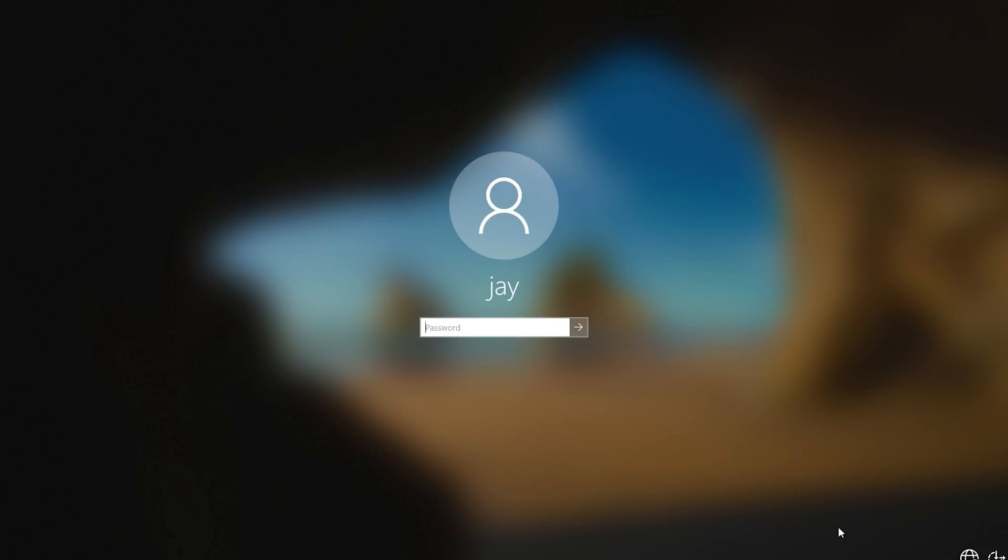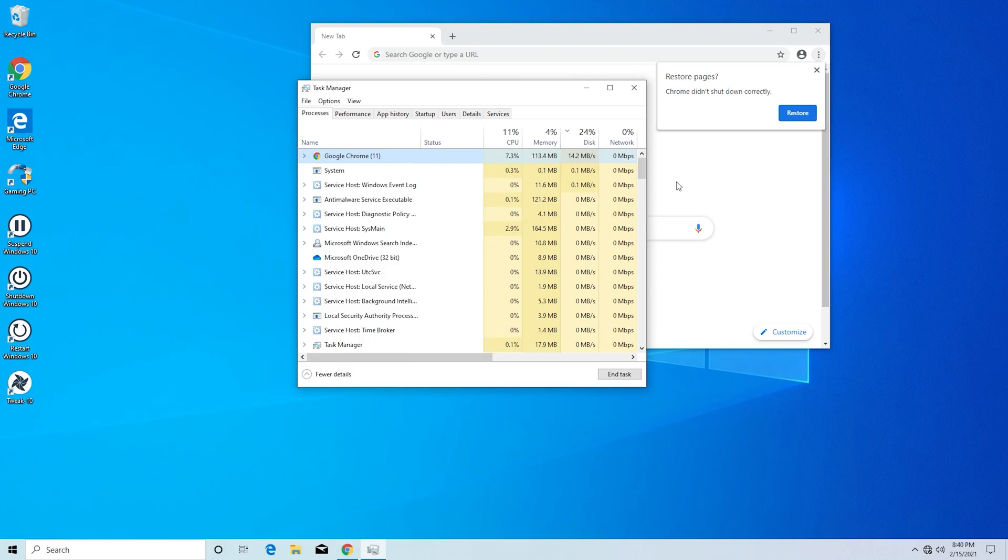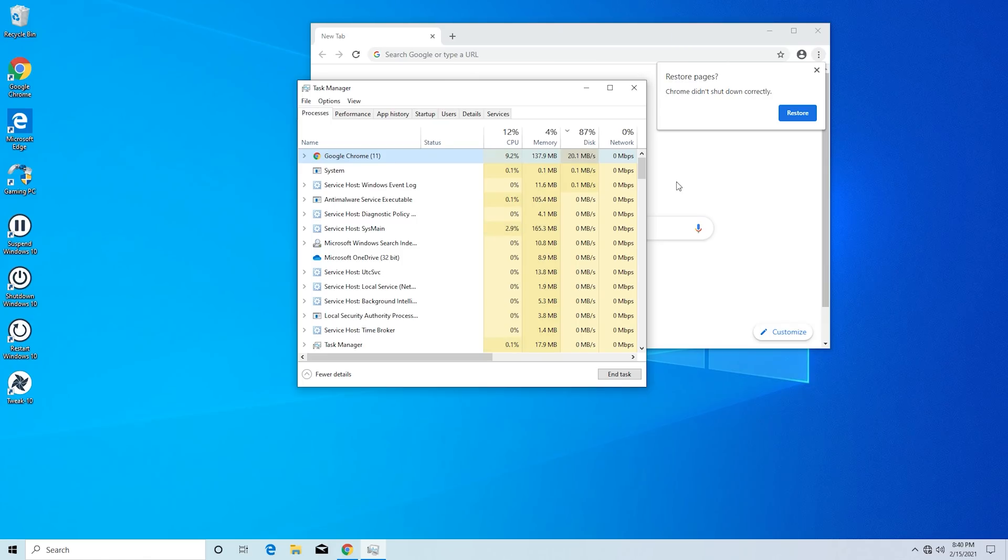Is this going to let me log in? I wonder if you can go through and remove the drive and put a new one on — obviously hot swapping should apply here — but the question is will it load into Windows or blue screen? We can do it — we are in! So when you put your computer to sleep, the RAM is still active. It's a little slow, and it's definitely reading stuff from the disk. Google Chrome using 100% of the hard drive is no surprise. Yes, you can remove the hard drive while the computer is asleep.